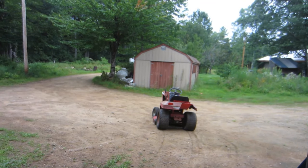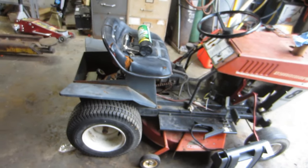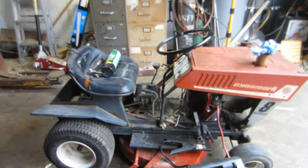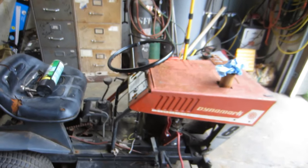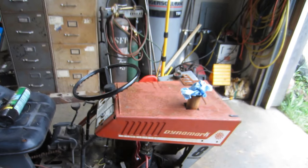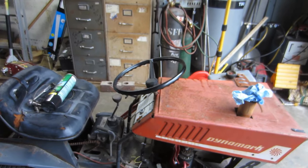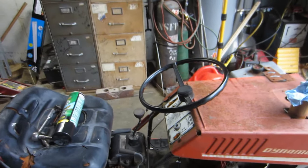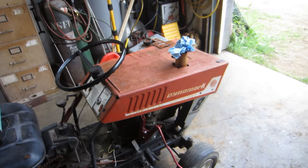So, yeah, I definitely think we need to hot rod this thing, though. I think that would be the best thing we could do with this thing. I know he's going back and getting a couple push mowers that he has. He's going to take the motor off of one of them and put it on this and get to where it can move. That motor turns over. Seems like it has compression, but it's not getting any spark, and he doesn't even want to mess with the wiring. He just wants to put a push mower engine on it, because this isn't even the original motor anyways,